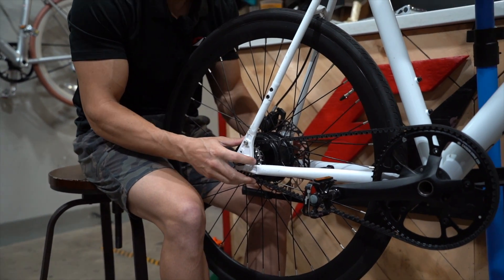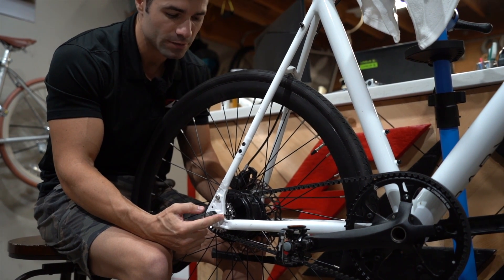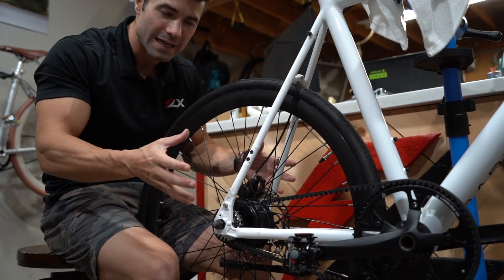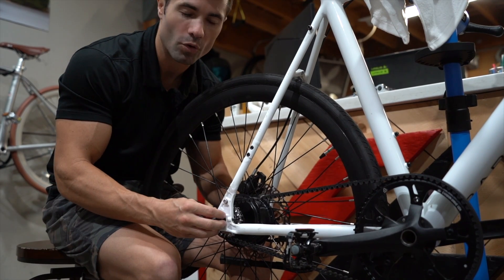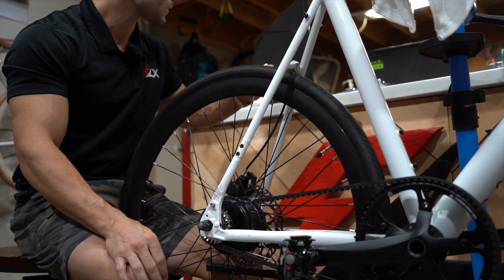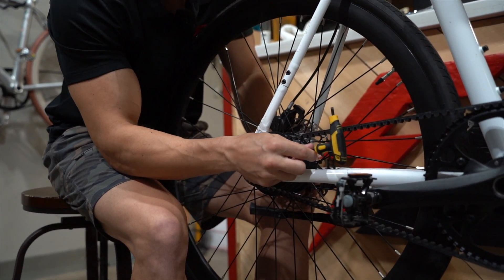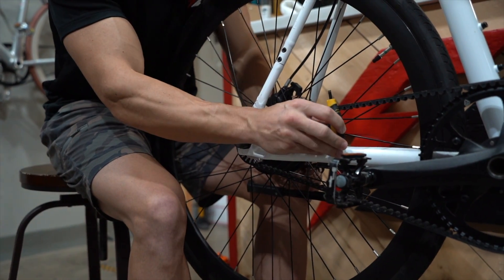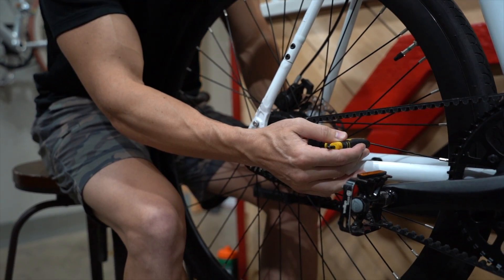What's keeping the tension here are these two screws, which are called belt tension screws or belt tensioners. They're pushing force up against this axle and pushing it backwards. When we loosen these screws, the belt can pull the axle in and the whole wheel in further, and loosen the belt. So that's exactly what we're going to do — we're going to try a quarter turn, maybe a half turn looser on this, which will allow some room to loosen up that belt. We'll try a quarter turn to start.